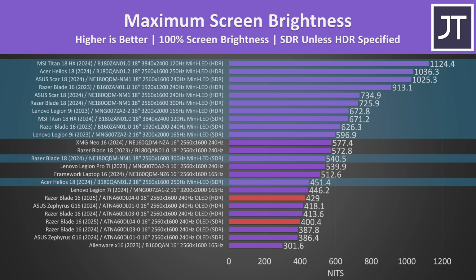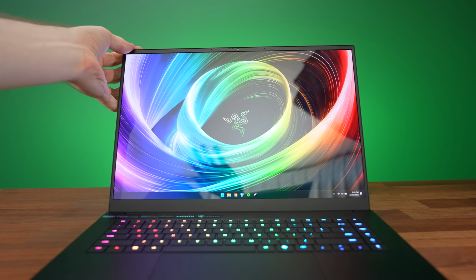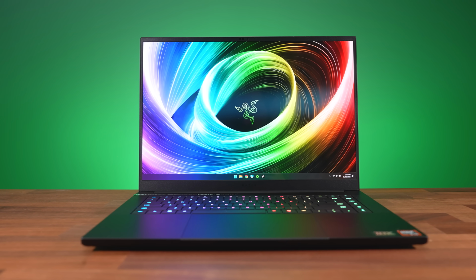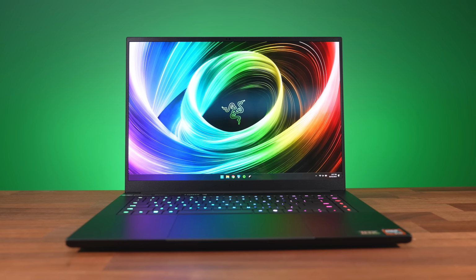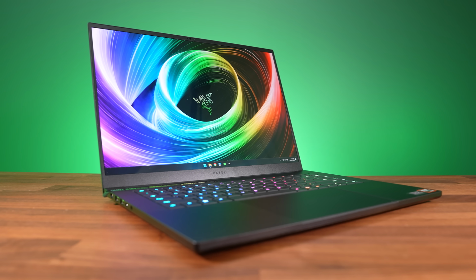In most cases, you've got to go for mini LED if you want significantly brighter, which was available last gen. Backlight bleed does not exist, as black results in pixels being turned off. The glossy panel looks nice, but reflections will get annoying if you're using the laptop in a bright environment. And like other OLED panels, PWM is used to adjust brightness, which may be annoying for some. Plus, there's always the possibility of OLED burn-in over time, though I haven't really heard of that happening in laptops, considering they've been available for years now.